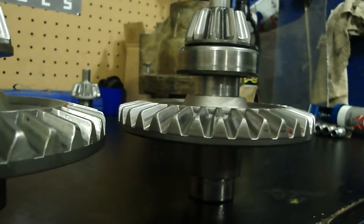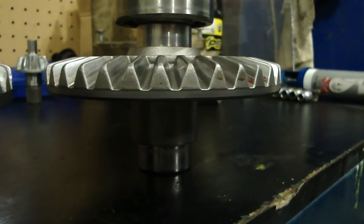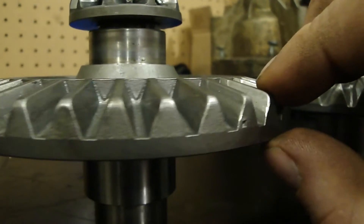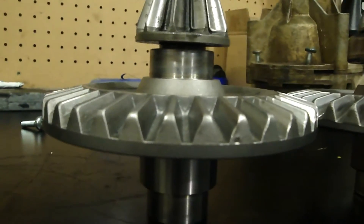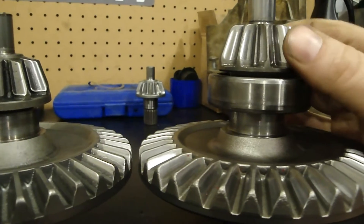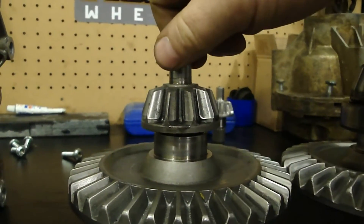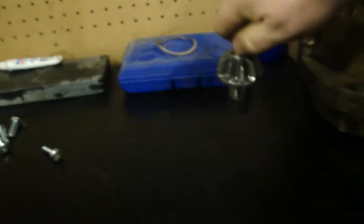I mentioned earlier that the ring gear had less surface hardening on the teeth. I say that because of the wear patterns and the shine that started on these teeth already after 100 kilometers. When you compare that to the 2012-2014 ring gear after some light use, there is no wear pattern, no shine — that's typical for a 2012-2014 ring gear. So why would Can-Am or BRP take surface hardening off the ring gear teeth? It's Mud & Wheels' official theory that they would do that to stop the wear pattern that happens on these pinion gears. You leave it long enough, it'll start to look like that — and eventually like this.